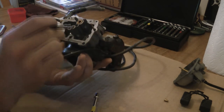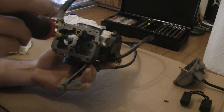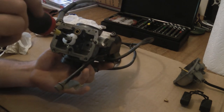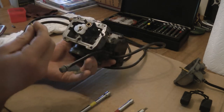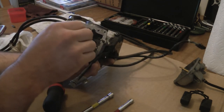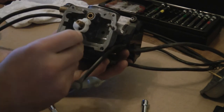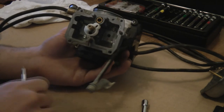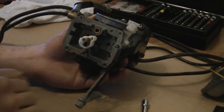First off, go ahead and put the choke plunger back in there and make sure it works. Then all the jets — put that on there. I forget what it's called, but then your needle jet. Tighten that down. With all these jets, make sure not to over-tighten anything — just make sure it's snug. Then your slow jet, your starter jet, and then your main jet. Next, the pilot screw. Make sure you've got all your hardware on there: spring, washer, O-ring. Screw that all the way in until it's firmly seated, then back it out however many turns you counted before. I'm going to go one and a half turns — call it good.